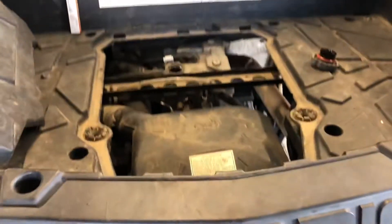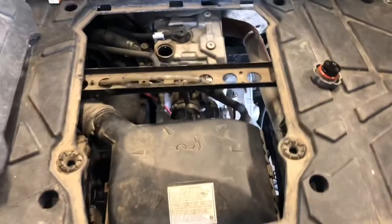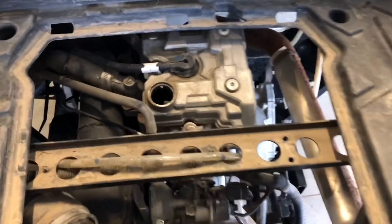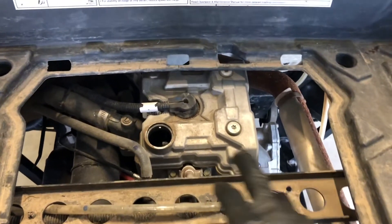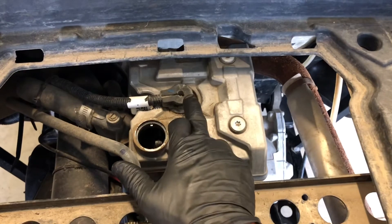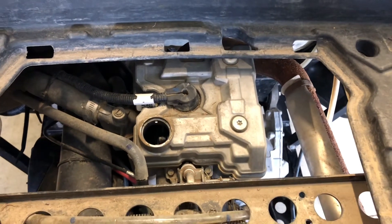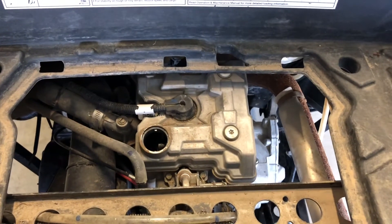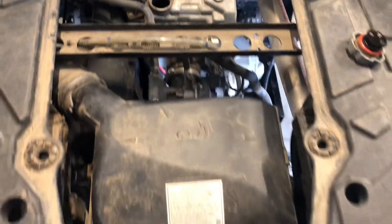Coming up to the engine compartment, there's a plastic cover held on by a couple of grommets and tabs up front. Your engine oil fill is on top of the cylinder head, and your spark plug cap is here as well. It takes an NGK MR7F spark plug — it's down in there, so make sure you have the proper socket to remove it.